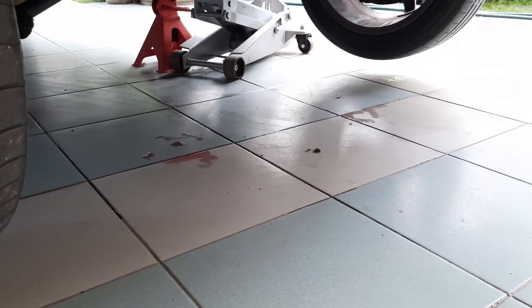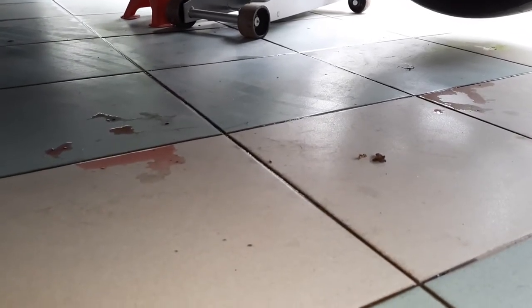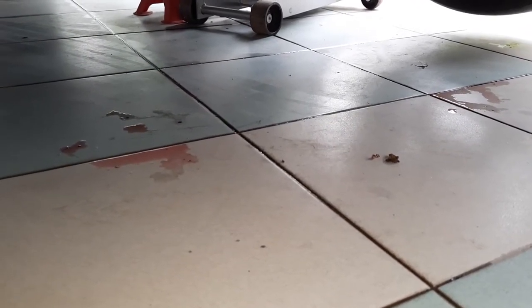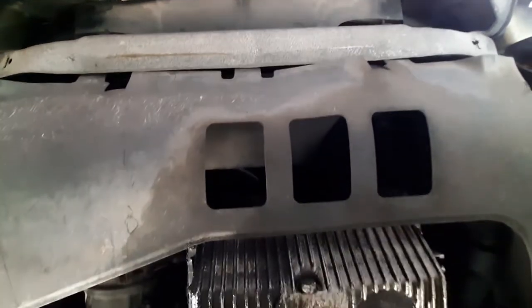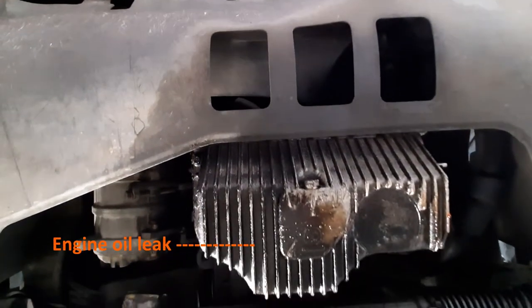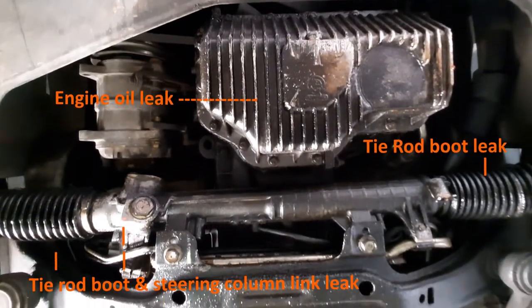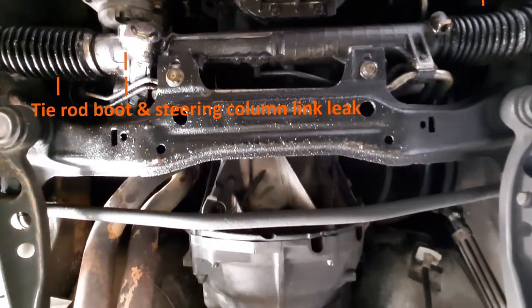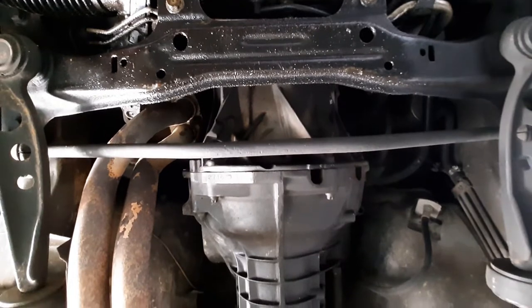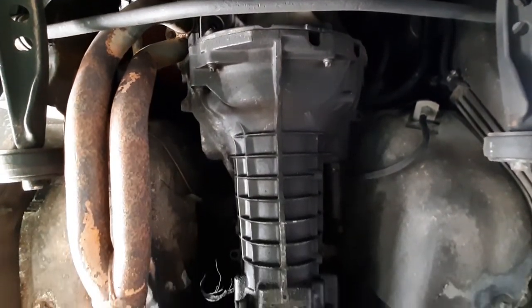Taking a look under the engine after running it for a minute, you can see some oil leakage — there's actually red and brown fluids here. Looking under the car, you can see the oil pan has some old engine oil on it; that's where the engine oil leakage is coming from. The steering rack has various leaks. The gearbox looks mostly all right, although towards the rear there is also a leak.